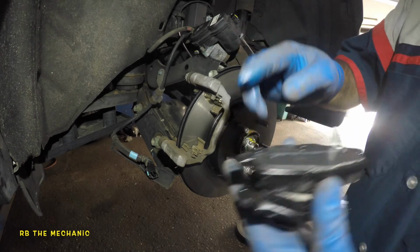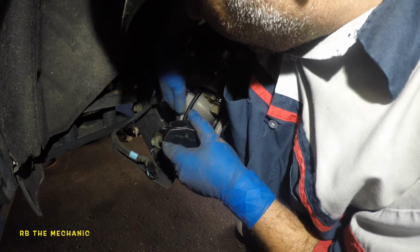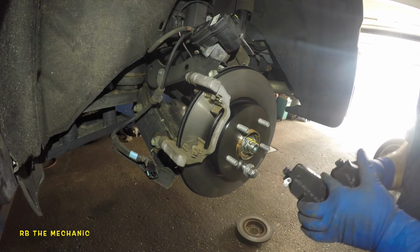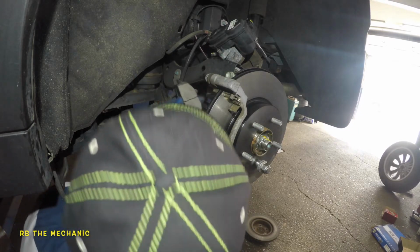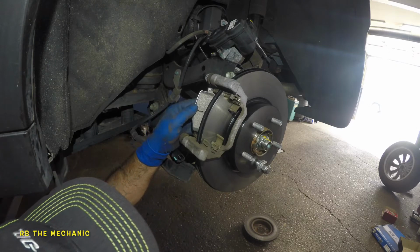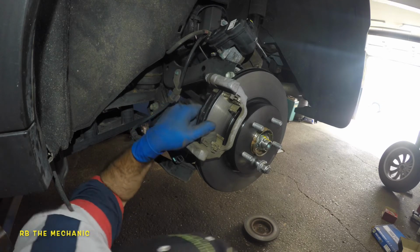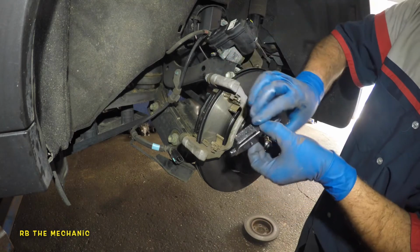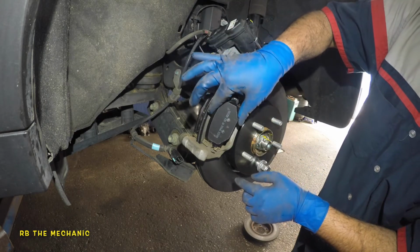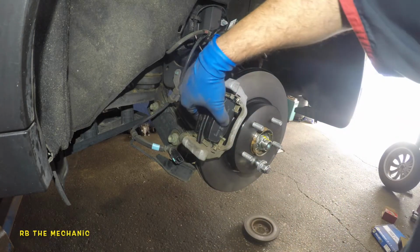So I'm gonna put this pad in the inside. Remember, the inside pad has three notches like that. So this thing goes in just like that. We gotta work some magic there to get that pad in. So I'm gonna have to go down in the bottom to get that pad. So what I'll do here is, it's a trick to getting this guy in. There you go, I got the inside pad in. So the trick here is, you put one side in, okay, you see how the shape is, that's how it's got to go, just pay attention to your old brake pad. So the trick here is to go around this little guy, and once you're in there, bada bing, bada boom, and they should be freely moving like that, okay.